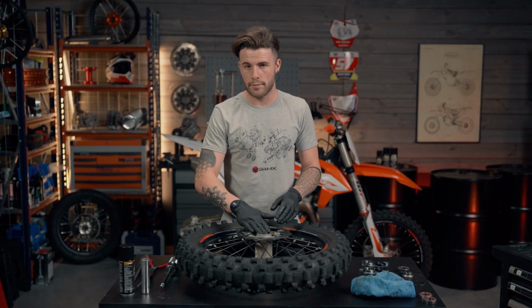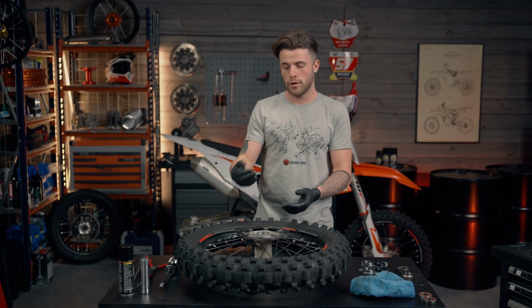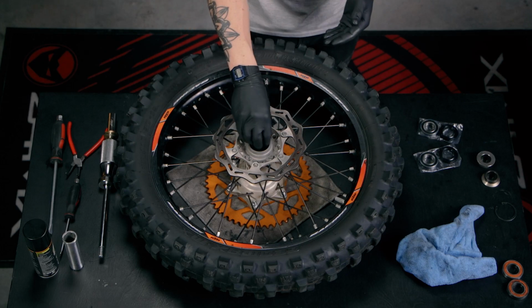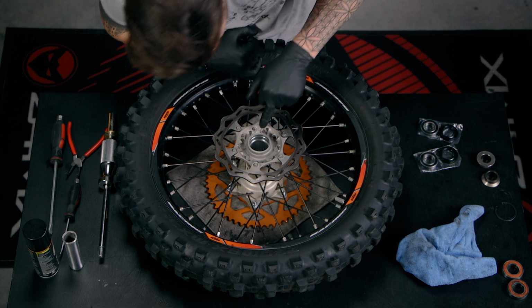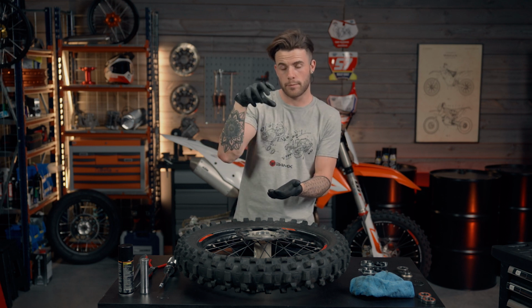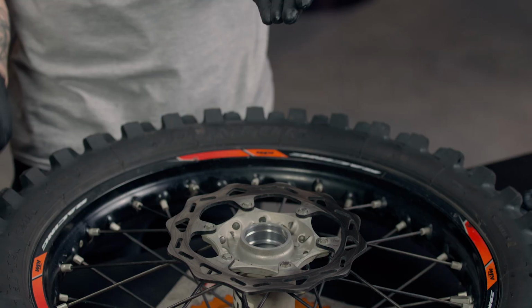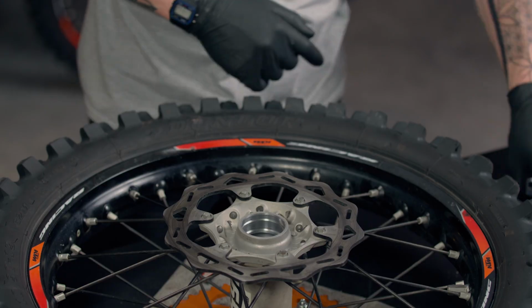So when putting the bearing in place and the circlip, when you come to flip the wheel over to put the other bearing in, you don't push this bearing through any further. So if we do this bearing first, so it sits down on the lip, which is further down the bottom, we know that bearing has gone in as far as it needs to. And then by putting the circlip on top, that stops the bearing being pushed any further up when knocking the bearing through from the other side. So we're going to do this bearing first.